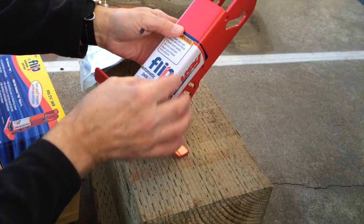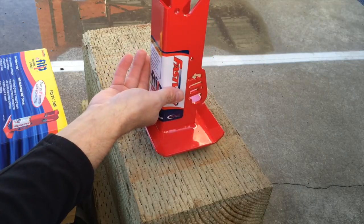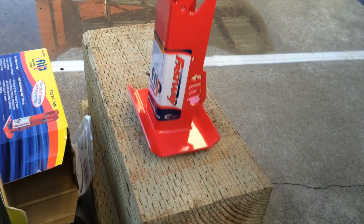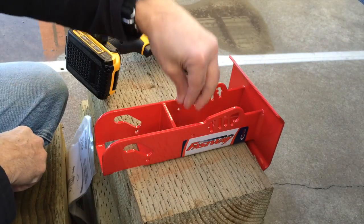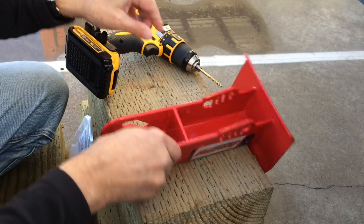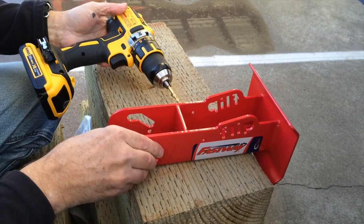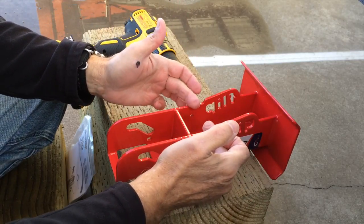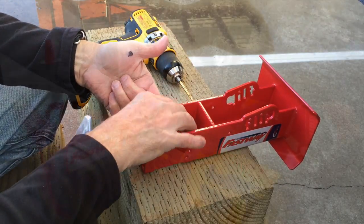Now if you've never seen one of these, basically what this is is the foot at the end of your jack. When you crank your jack up, this will pull up and then stow itself in this position, and then when you lower your jack it'll automatically deploy and you've got a nice solid surface on the ground. The way this works: we put the foot down, put the jack post down through here, and there are guide holes on this side and on that side that you basically run a 3/16th inch drill bit through on both sides for a pilot hole. You lift your jack up and then through those pilot holes ream them out to half inch, and that's where the bolt will pass through on this end of the flip foot.